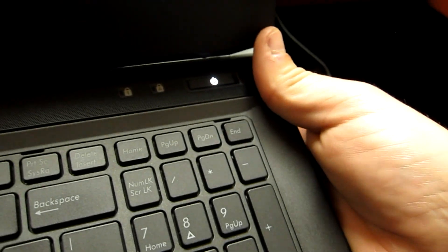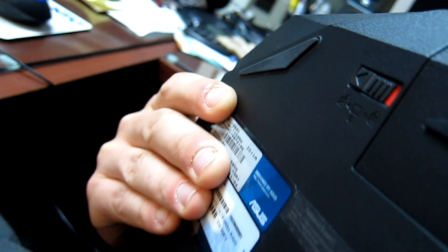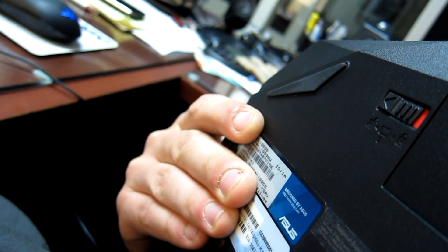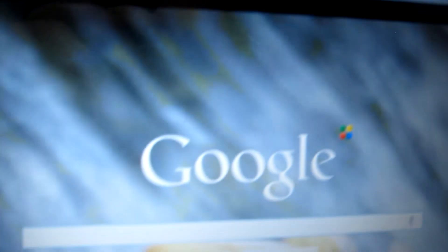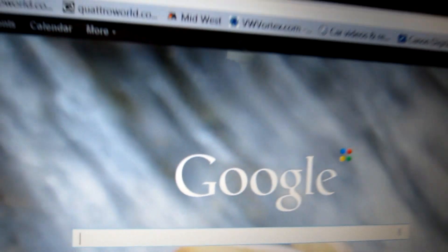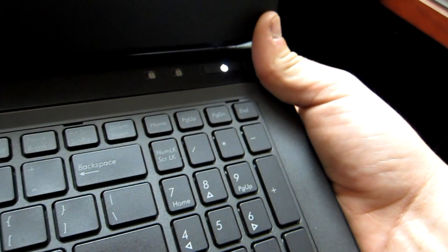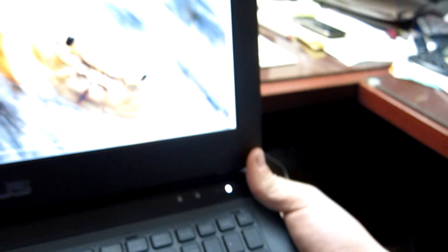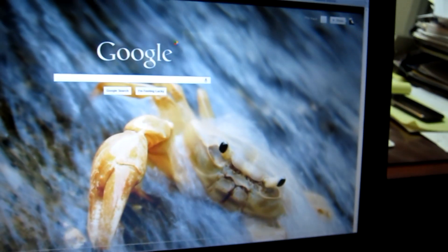So where I'm pressing is actually right here. And if I press there, the yellow is gone — press and release, yellow comes back, press again and it's gone. So that tells me this is a physical problem with the hardware, and that's probably something that's going to have to be warrantied.